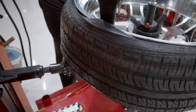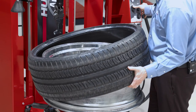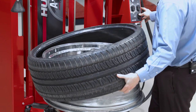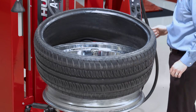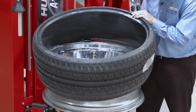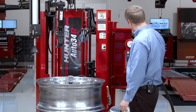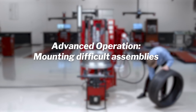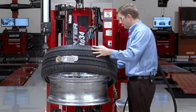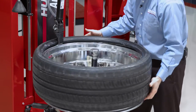You can actually see it take some of the stress off as the bead starts to pull off. I've got that nice variable speed so I can move slower or faster as needed. For the bottom bead demount with the roller, the key point is to make sure the opposite end of the bottom bead stays in the drop center. On this particular tire with a really skinny sidewall, I'm going to indent that lower roller before I start to rotate for the demount — that ensures I don't bunch up the skinny sidewall. Give a little bead lube here. With the memory position already set, that's a step I don't need to repeat as an operator — I can set it once for each wheel size.